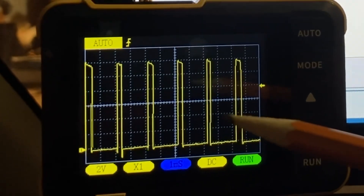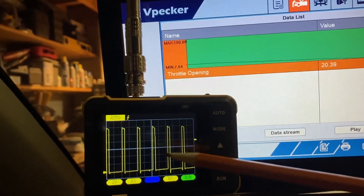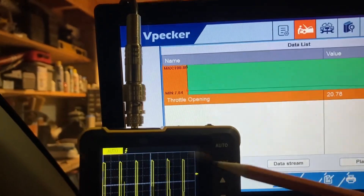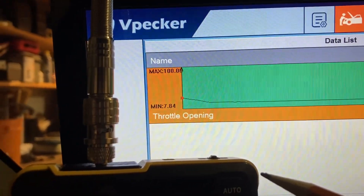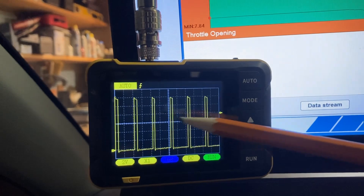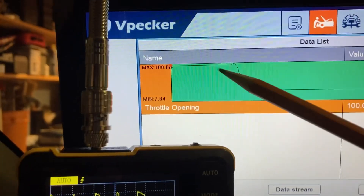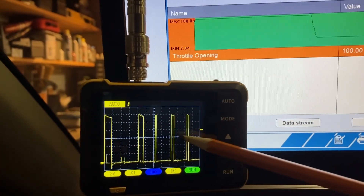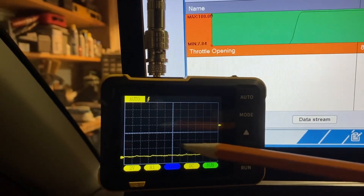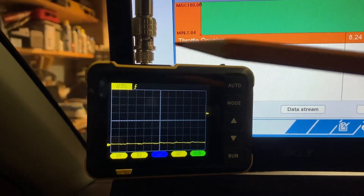This is the open side of the drive motor pin. I'll ramp the throttle open — there's the duty cycle, there's the width of the duty cycle — and I'm slowly progressively opening the throttle. That signal stays there because it's working against the closed spring; the motor has to generate enough torque to keep it in a fixed position even when it's not changing. You can see the open windings being powered, and how wide the pulse is is a function of the rate.